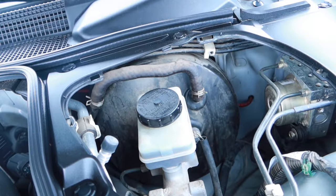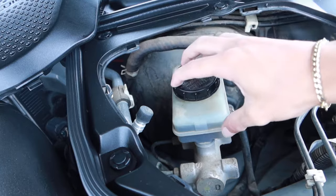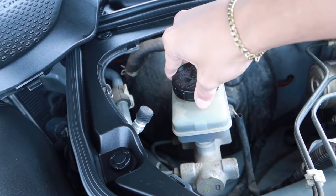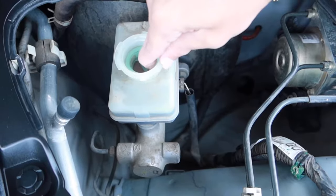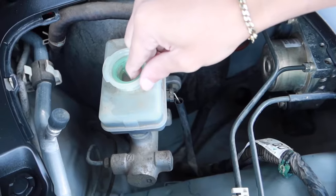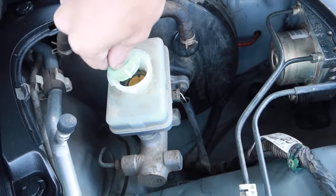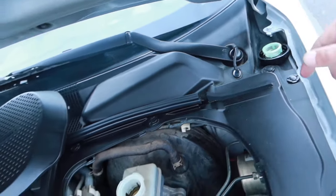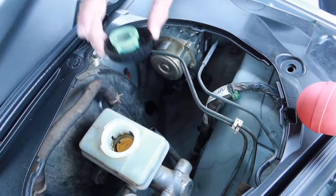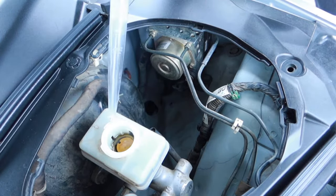Let's pop the lid open and uncover our brake fluid reservoir — this system is called your brake master cylinder, but for the purpose of this video we'll just be calling it the reservoir. Go ahead and take out the cap. Inside you'll see a little filter; you're going to want to pull that up very slowly, just prying on the sides. It's a plastic piece with some screening — just to filter it out. We'll put that on top of the catch can so we don't contaminate anything.